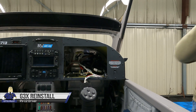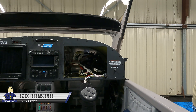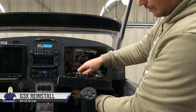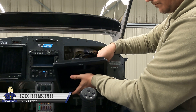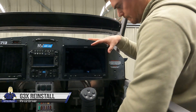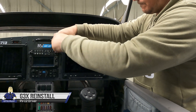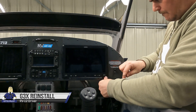To wrap things up: this fan uses 50 percent more power — about 100 milliamps more each, or 200 milliamps more total, which is a quarter amp. I think that's fine for the RV-12iS and most likely fine for the original legacy RV-12 as well. I don't really know if you'll realize the full benefits though, because there are holes cut out in the bottom of the instrument panel that will restrict the airflow anyway. That said, a fan moving more CFM even through the same restriction should try to push more air through those holes.